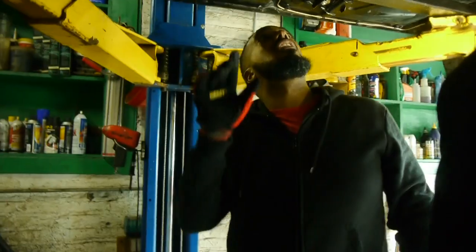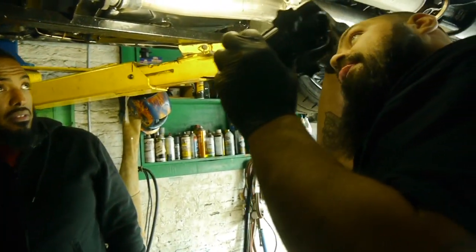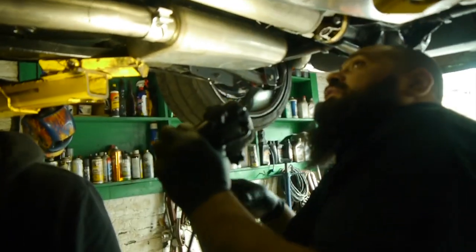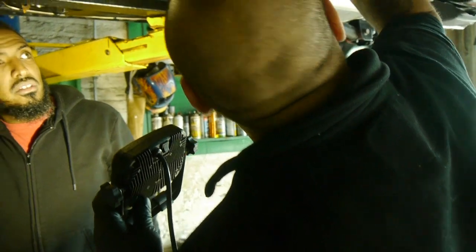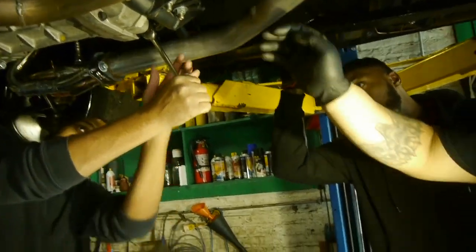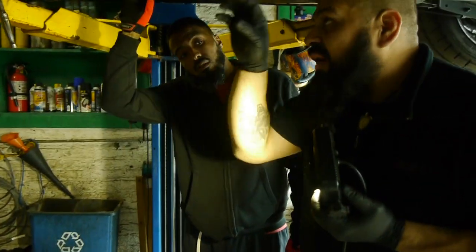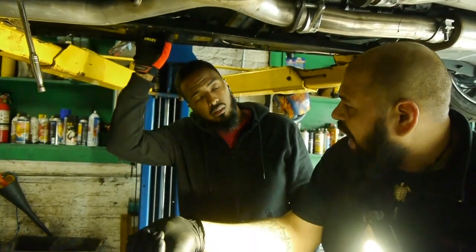I don't know if we could get all of these through here like that. I would say go through the top. Inside? No, stay up here, because that's what I'm going to do to Reckless. I don't want the fuel line close to this. So we're going to go from the tank, a straight shot right through the top, right in the middle, and bring it out on the top. For Reckless, that Coyote has the gas line where you plug in right there. If I could put the regulator in the middle, and then a small braided hose to the gas line, it'd be perfect.